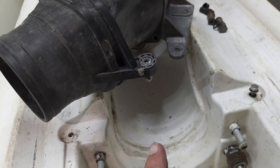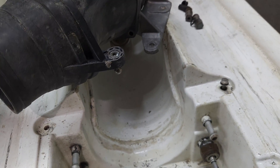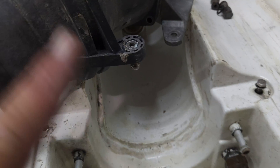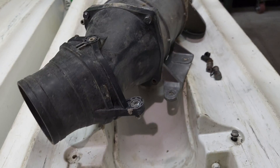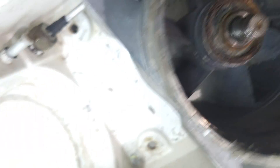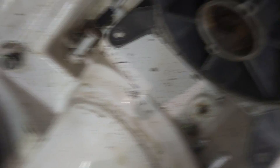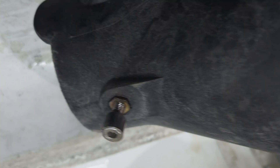We've got to install the pump and the driveline carrier because that's bad too — we need to have all that in line. We set the adjustment for the bearing carrier with the engine installed. We'll do all that, set it all up, install the pump permanently. I ordered a 15 — a straight 15 impeller for this. I found one used for a good deal. As you can see, the pump is in really bad shape, but the vanes and stator sections are all straight. So we'll rebuild, replace the bearings, get a different impeller. As I said, everything is wrong. So this here, as we've got wobble, we're going to push these edges down with the plastic soldering iron — it'll stiffen those up a little bit and we'll be able to reuse that.